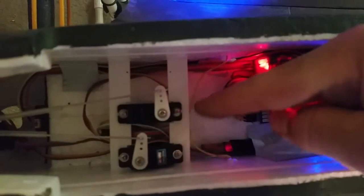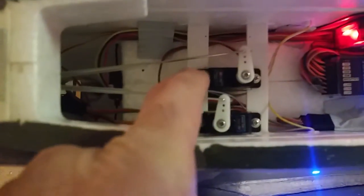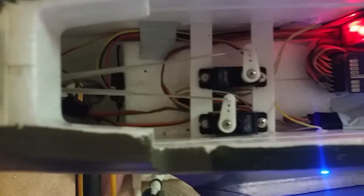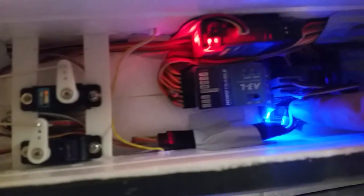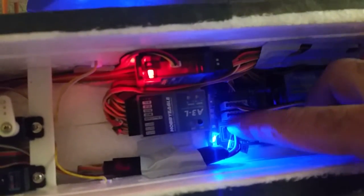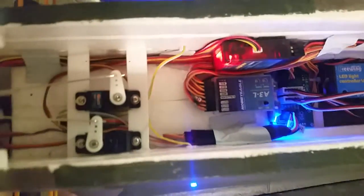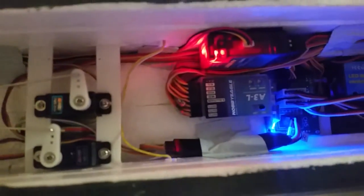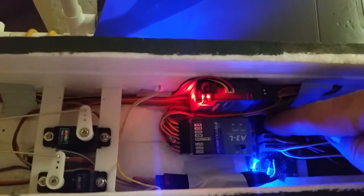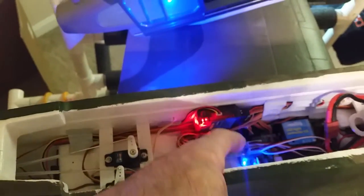You can kind of see the wires for it right there, and I'm using a LumaFly FAA light system because it's really tiny — you can get it from Hobby King. You plug it into any channel and it's got a jumper on it. I have it plugged into the board right next to the retract, powered off Channel 5 on that board, so when the retracts come down it just feeds power to it. If you put it on other pins it'll go on and off with rudder, elevator, or flaps — but I wanted it active with the gear.